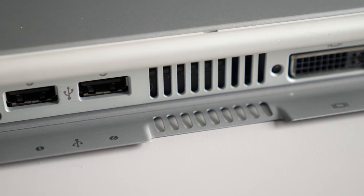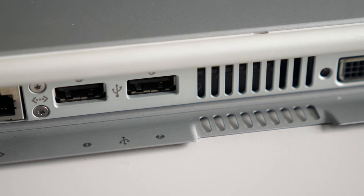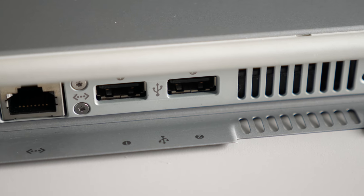Well, most people would think, I'll just build a USB flash drive installer and boot off of that like you would on a modern computer. Well, the wrinkle is that these PowerPC-based Macs generally won't boot off of USB. Not that you'd really want to anyway, simply because a lot of them shipped with USB-1 interfaces instead of USB-2, which would be just incredibly slow to boot and install an OS from.